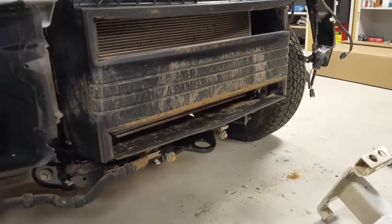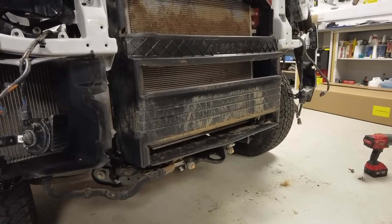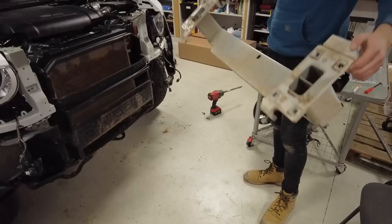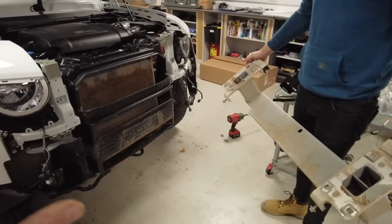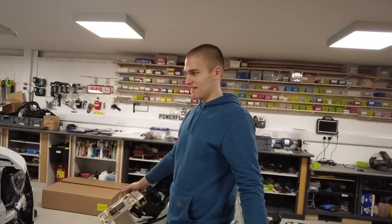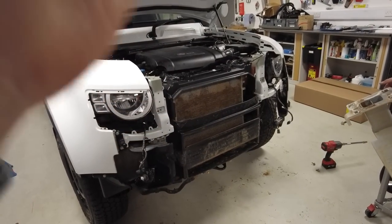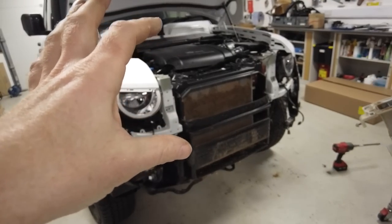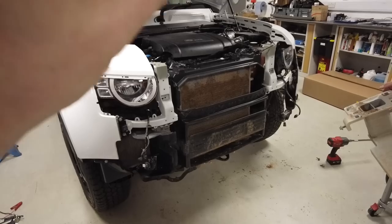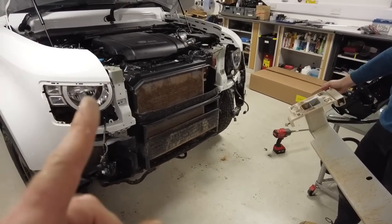I think we'll finish that video there for the day. We've finished for the day, I'll upload that. So that's part one. So that is basically stripped down, armature removed, all the front, that's aluminium, is it? There we go. So have we damaged any looms, Tyler? Not that we know of. Not knowingly. Right, so there we go. That's part one of the front panel strip down. And in fact, that'd be quite a good video to stand alone because you might want to do that even if you're replacing something, not winch fitting. So we'll do that, how to strip the front of your Defender down, remove your armature. Good luck with that.